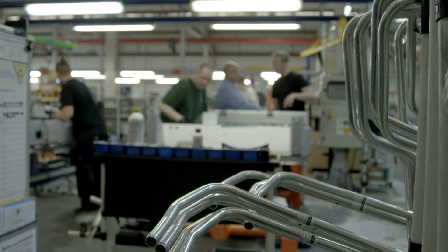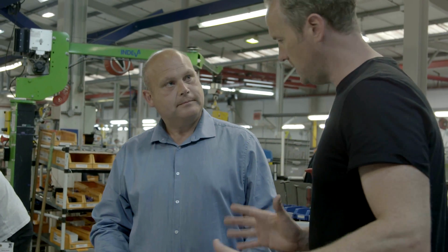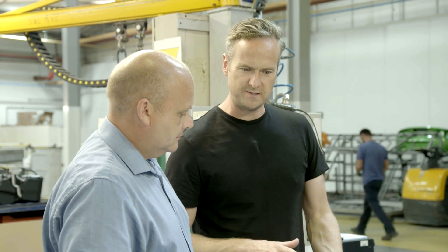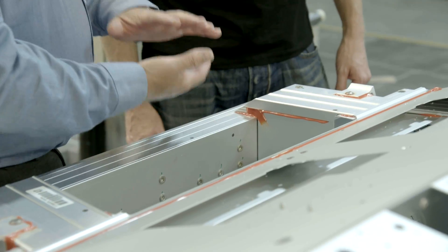Hello mate, how are you doing Tim? Nice to meet you. I've noticed that you're using bonding to actually adhere the components of this chassis together — why are you gluing them? Aluminium, so we don't want to be welding and adding heat. And obviously bonding is very, very strong in shear.